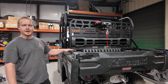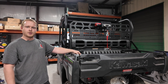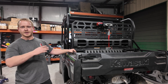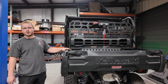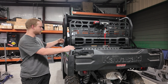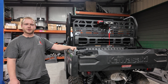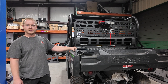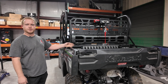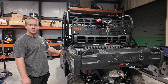Something to keep in mind when using the bed in the minimum position with the bed tilted up: when loading something into the back, be careful once the load is placed into the bed. The strut used to lift the bed up is not very strong — if you load something that's 200 pounds in the back, it'll force the bed down and possibly slam you or other objects into the bed. To recap: if you're going to use the winch on your headache rack with minimum bed space and the rear seat folded down, you can use it in either the bed down or bed tilted back position. With the bed at max extension and rear seats folded forward, only use the headache rack when the bed is down and clamped securely using the fasteners on the driver and passenger side of the vehicle.